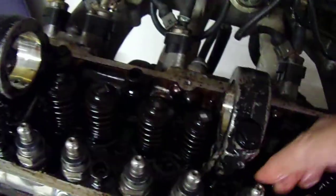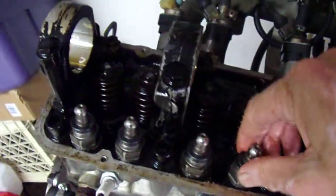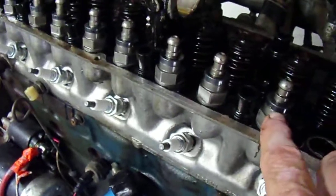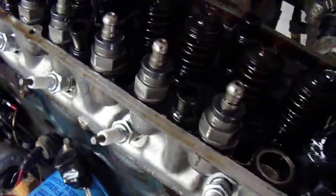These are the retaining caps — these little things I'm twisting right here. They should all be loose but fully snapped on. You can't snap them on unless you compress these things a little bit. To take it off, you remove the pivot, then get a little screwdriver and pry this little cap off. Then it all disassembles pretty easily from there. You just have to make sure you don't lose the little spring — that's the hardest part.